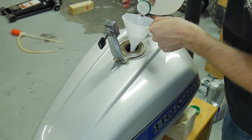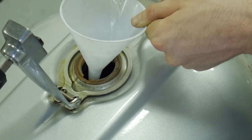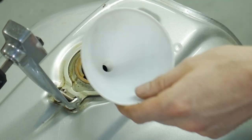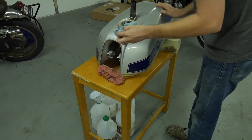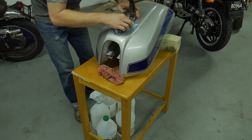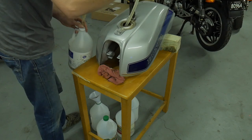That does happen in this video because there's no other real way for me to get that rust out. Distilled vinegar, very low acid — I can really cut into that rust and get it all to break free. I use about five gallons, rotating it. I'd rotate it every maybe six hours, get it up onto its end, pull it up to the top. The very most important section of the tank that people miss is the very top layer — that top coating. It's hard to get to and we've got to make sure that gets out of there.